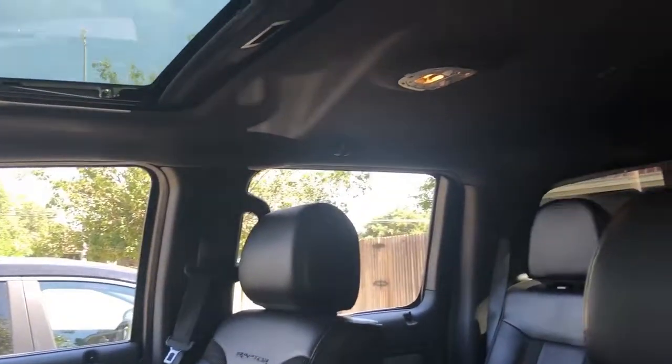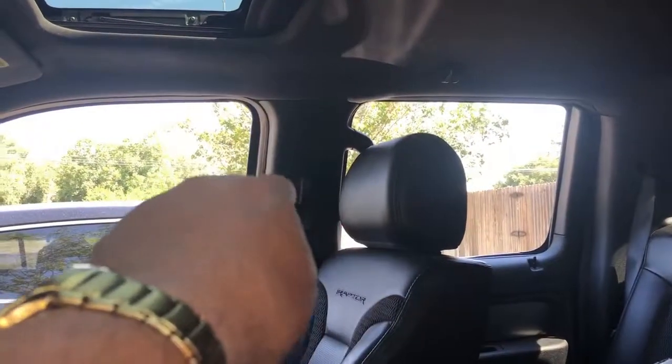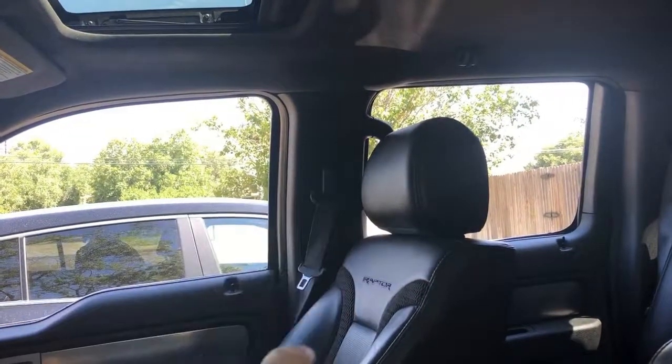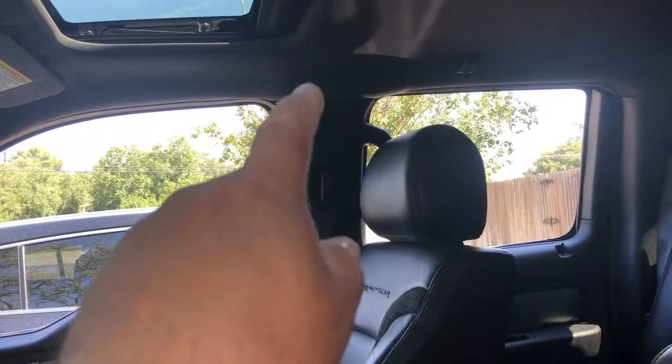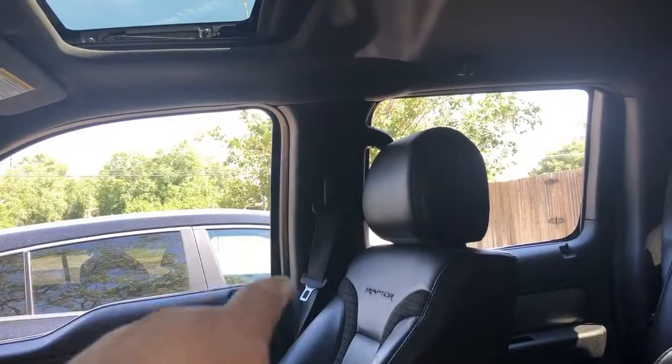And then of course I'm gonna have to go back and pull these pillars again, where the seat belts were on. Remember, I had to take those off to do the seat belt, so we're gonna have to pull those back off. We're gonna have to pull the seals down from around the doors, and we're gonna have to pop the screws, like the one up there for the hooks. And then in the back there's a few screws or little clips that need to come off. If you can see them right there and right there, we'll take those off.